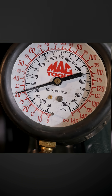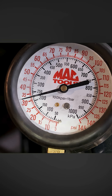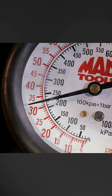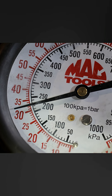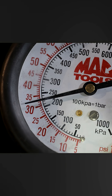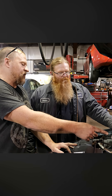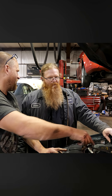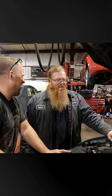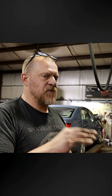Key off, go into the next injector. That's what I wanted to see — except, I mean, I'm excited, but that was a little premature excitement because I got about two PSI difference on that injector compared to the other three, but it's less flow, not more flow.